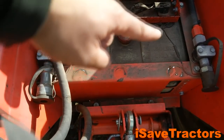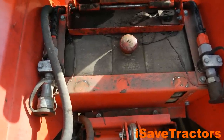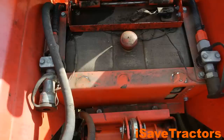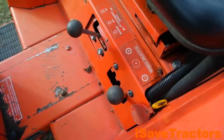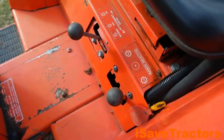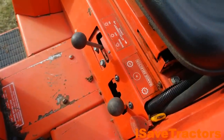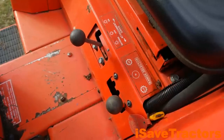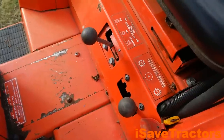This particular tractor has a hydraulic PTO, so in addition to all the other hydraulic valves, I also have a hydraulic motor valve mounted on this tractor, so I can run hydraulic implements such as a mower deck, a tiller, or a snowblower. Ingersoll made all of those hydraulically powered, so I don't have to worry about any PTO belts or clutches. This provides a more positive transfer of power without belt slippage. This hydraulic PTO setup gives me the power to custom-make an almost infinite number of things.